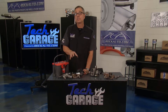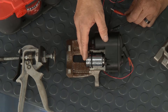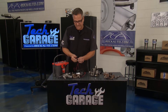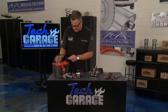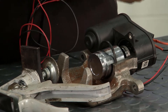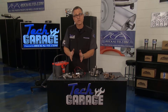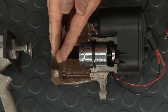The key is, once it's all done, I'm going to have to go inside the car and put it in operational mode. Remember, it's retracted all the way. Old school, we used to just pump the pedal to get the brake pads out there — well, no more. I want to go ahead and engage that parking brake and get it to work. I'm going to reverse the leads and put the motor — it's a bi-directional motor — going in the other direction. Watch the piston: it's actually running that piston out. When I put it back in operational mode, we're going to get the pads out so there's just a little bit of clearance between the pads and the rotor, so when you go to stop, you'll have full contact. Or, if you ever push that e-brake switch, that's how it operates — it pushes it out and it pushes it back in.